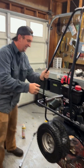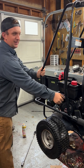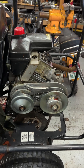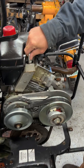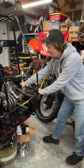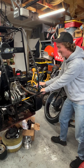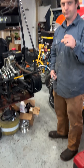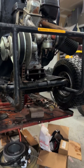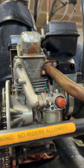Go a little quicker this time. Watch and learn. Oh, it's exhausting now. Come on, Betsy! Well, we got rid of the questionable springs that were attaching this thing. Now we're going to attach the throttle cable to the bottom of this governor arm so that it's wiggling the throttle like so. Oh, she's wiggling!